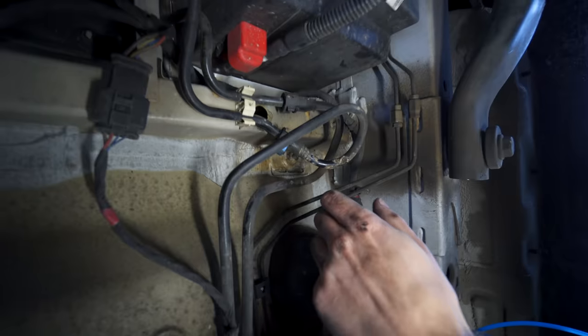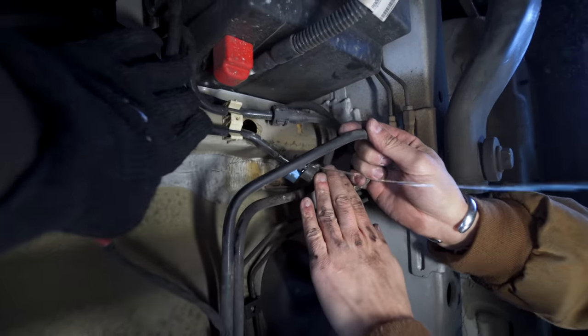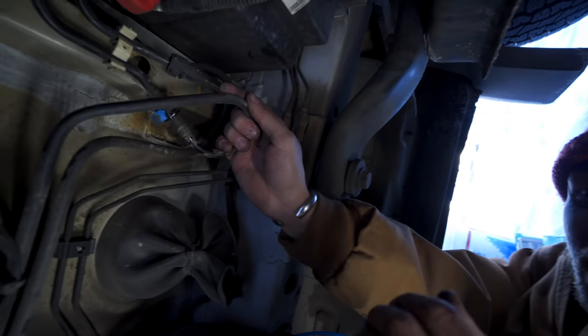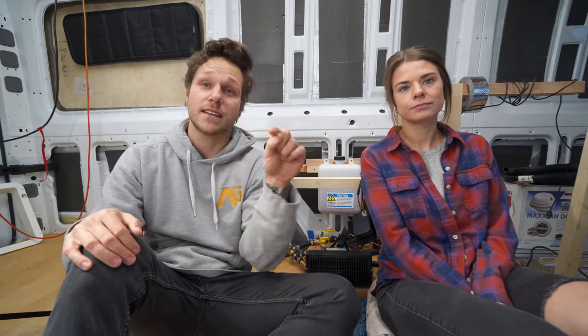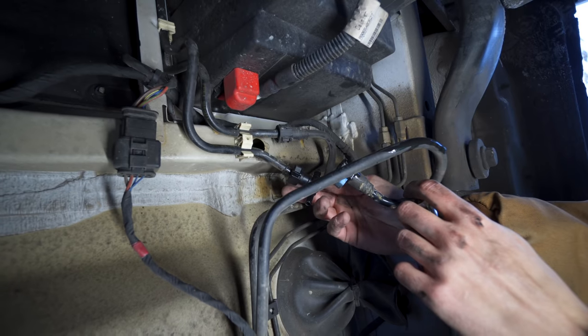But we had nothing. So then I thought, well, there's still these quick disconnects that are running through the main fuel line and the return line. Maybe I can pop one of those off and connect to it. And within the instructions, it even says you can connect to the return line. Just make sure not to create any 90 degree turns within that line. You don't want to disrupt it. So I thought, cool, I'll still use this T and connect to it.